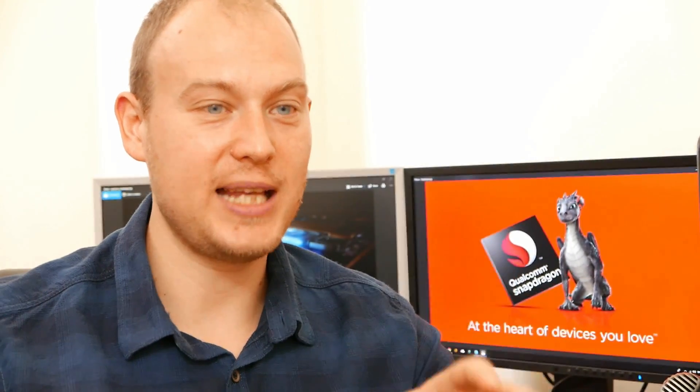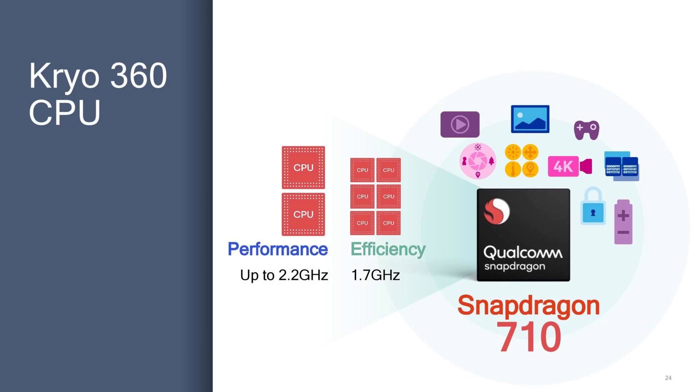Because the Snapdragon 660 has four big cores and four small cores, and the Snapdragon 710 has just two big cores and six small cores, you might think performance-wise the Snapdragon 660 will be better. Well, this is not the case, because the A75 and A55 pull up around 20% to 25% improvement over the A73 and A53. The link between them — how they communicate — has also been improved and yielded more performance. So they've compensated the two fewer big cores with better performance on the A75s and A55s, and in doing so they're saving more battery because the chip is smaller.